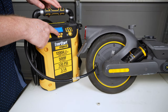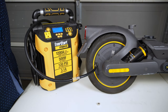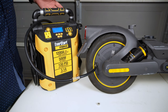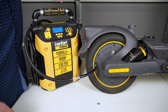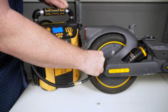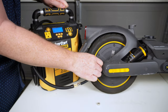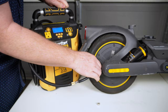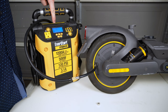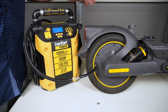I'm going to fill it up to 46 PSI. All right, we are now at 46 PSI. Now I'm going to remove this as quickly as I can — there's a lot of air that escapes out of that valve. When I reattach it as quickly as I can and look at the PSI readings, we're at 38.5, which is a lot lower than the 46 that I wanted in this rear tire.